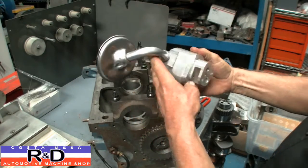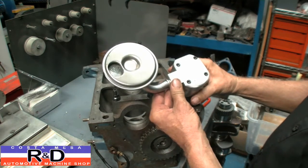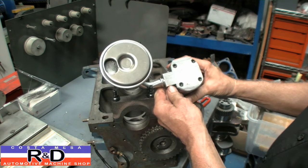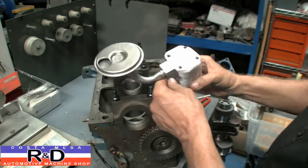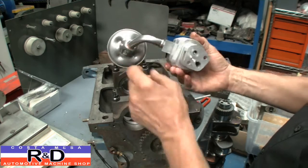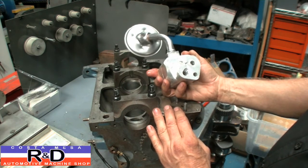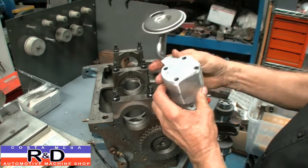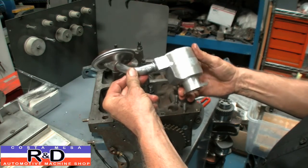Well, I think as you can see, the high volume oil pump that we made puts out considerably more flow than the little Fiat pump. In fact, you could see that the drill motor wasn't even spinning at full blast and this one puts out way more volume. So if you're going to be racing, this is the kind of thing that you need to have for your car. I don't know that I would recommend you trying to make one of these unless you have a mill and a lathe and all the other bits and pieces - it's a bit complicated. But we expect this to work quite well. John Costa Mesa R&D, we'll see you soon.